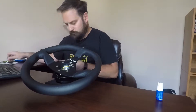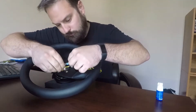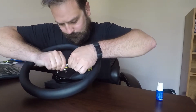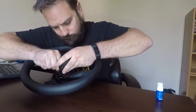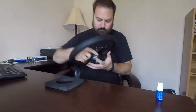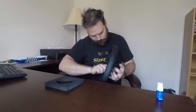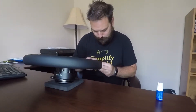I had to make a short adapter wire for the horn button. The horn button itself has two male connectors. The quick release has a female and a male, so the male from the quick release will not plug into the male off the horn button. Using some stuff from a parts store, I made an adapter wire to be able to plug this in. The horn button then just presses into the middle of the steering wheel, and then I just apply the sticker on the steering wheel.